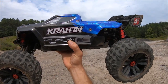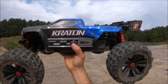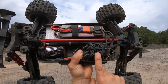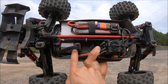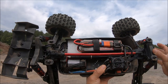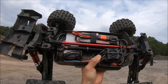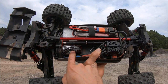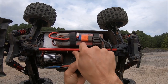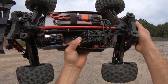I'm going to do a little more of a freestyle bash — no big ramp jumps right now. I came out to a little freestyle spot I like. This video may be a little more uncut, just to try something a little different. I did go ahead and switch out the electronics. I have the BLX 185 and I went to a Team Corally Skeeter 4S motor — the Kuron 2150KV, which is a 40-size can. It should be a perfect motor for this truck. I'm running a 19-tooth pinion and a huge HRB 9500 milliamp battery pack, so it's going to have lots of run time.